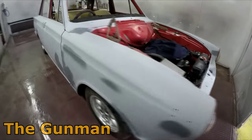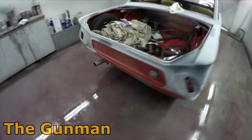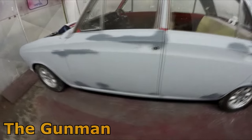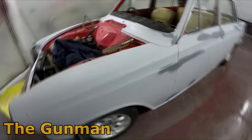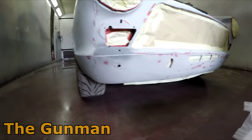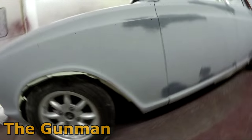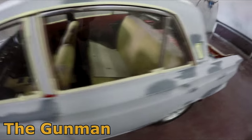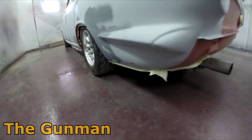As you can see, that's all the prep work done. I didn't focus too much on the prep work in this video — it was just a bit of a walk-through. What I did to finish off was 500 grit on the orbital and then by hand. I then gave the booth a really good sweep out to make sure there was no overspray left on the floor, then dropped some water down and spread it around so that when I'm painting, any overspray will stick to the floor rather than bouncing back up and landing in my paint job and turning into dust. Then I went around all those edges and edge-masked it, ready to throw plastic over the entire car.